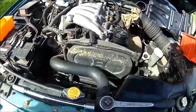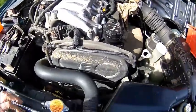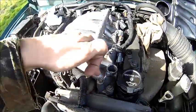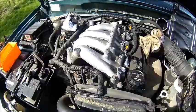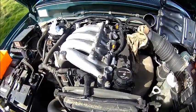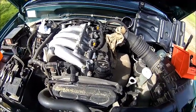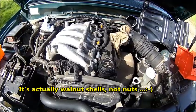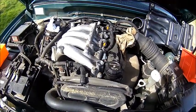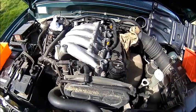Perhaps we could do a compression test. I know it runs okay. To clean the manifold you need to take all these nuts and bolts out and take the manifold off, and then you can actually clean the intakes because they're most likely full of oil crud. It's a GDI engine so there's no fuel coming through the intake — it's all directly injected and that causes oil crust on the valve stems and on the intakes. Mitsubishi has a jig where they use walnuts to blast it — because they're soft, if something goes into the engine it doesn't cause harm. But I don't have that, so it's a job for the summer, but it needs doing because it's got 60,000 miles and it's probably pretty coked up inside.